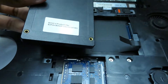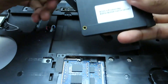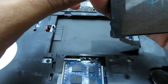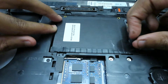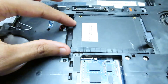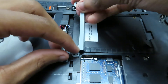To replace the new hard drive or SSD, reposition the rubber strips on the side. Then slide your entire storage device into the SATA port until it clicks and is connected. Re-screw the metal bracket with its two screws to secure it.